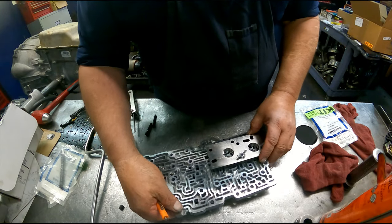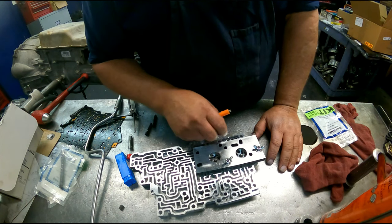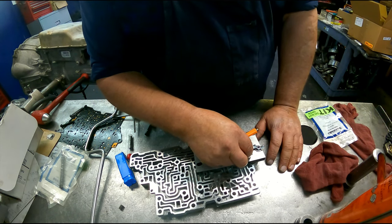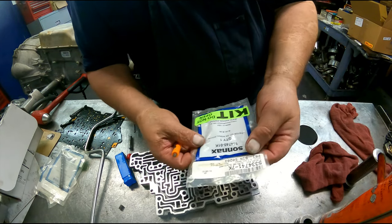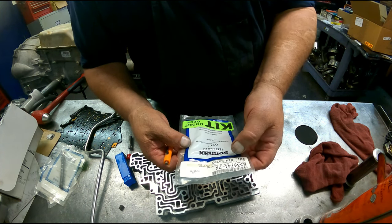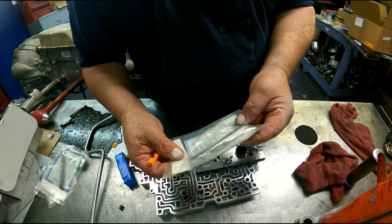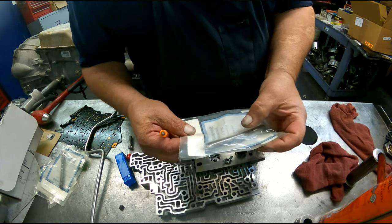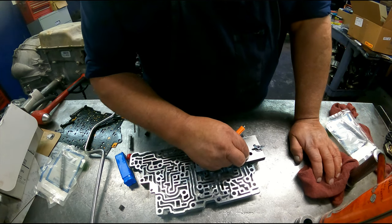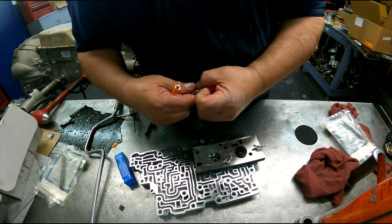On the Gen 1, they're wanting you to put these bolts in here. Here's our lineup plate — it says 'this side up.' The tool kit is from Sonnax, it's a T-124740-TL40. The accumulator kit WIT number is S334741-7K, and the Sonnax number is 154740-01K. You're going to get seven of them in the kit. Put the bolts in here to line this up, and you get a lineup pin.